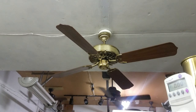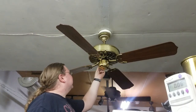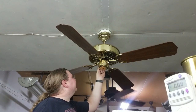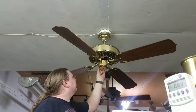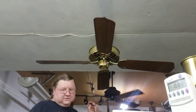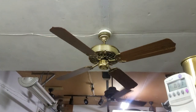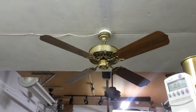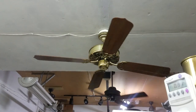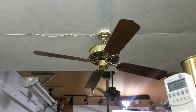Here we go — there's low. It's set pretty low, so I'm going to have to start working this one up. At least I can get a low speed out of it. Casablanca normally, it seems like the low speed trim was usually set pretty good. I wonder if it's stiff bearings causing this not to start, or it could just be that the low speed trim needs to be adjusted. It was raised a little because it was all the way down and it did nothing. It's just uncommon for Casablancas to have that.